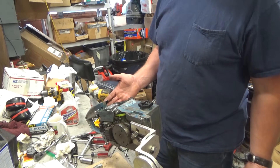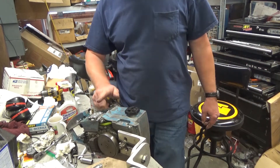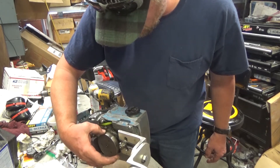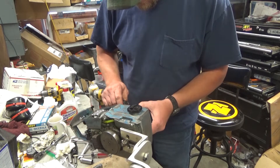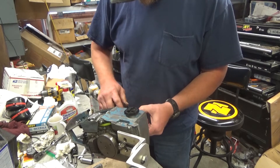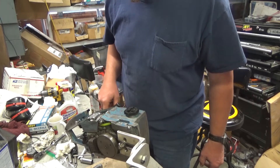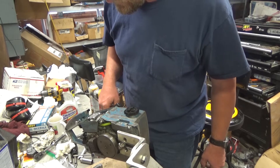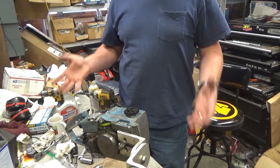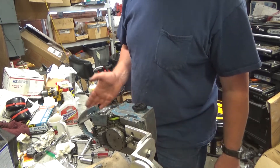Got a few things I still need to do — get the oil line back into this one. I think I'll pop this drum off and go ahead and get a fresh rim on there. I noticed as I was running it that the starter pulley is kind of wobbling around a little bit, so I'll check and make sure it's got an appropriate bushing. The big thing on this saw was that the piston and cylinder were just done — they were power done — so this has a fresh piston and fresh cylinder.